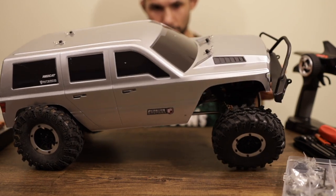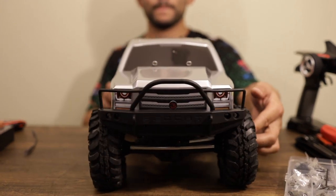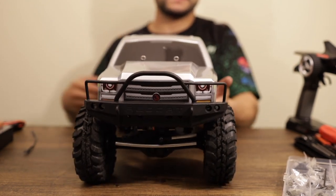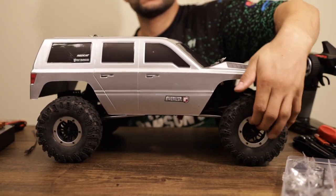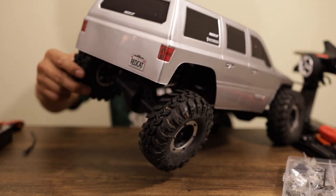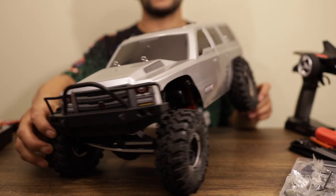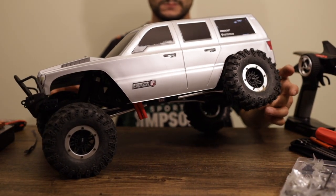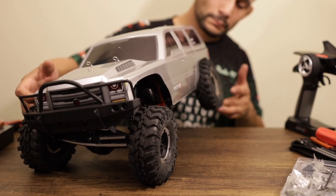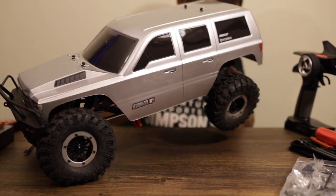Look at that flex — that is great. You're going to use up all the suspension travel that the Red Cat came with. So much better clearance on there. It's so much looser, it's not fighting against itself anymore. So if you guys were having some issues beforehand with your Red Cat, watch this video a couple of times. Hit that like button and subscribe button for me, please. On the next episode featuring the Red Cat, we're going to be taking this thing out and doing a newbie rating system where we're going to be rating all of the crawlers and making some categories to see what the score is. I appreciate you watching — I'm the Arkansas RC Newbie, and I will see you on the next episode.